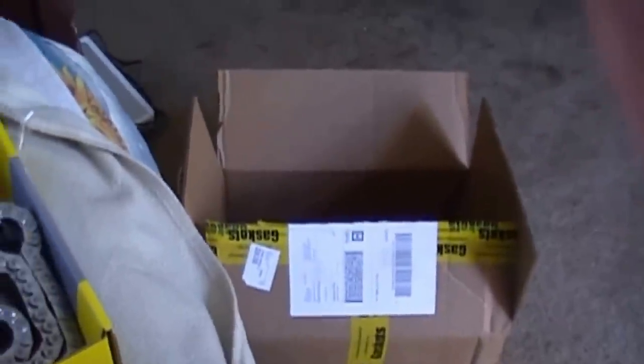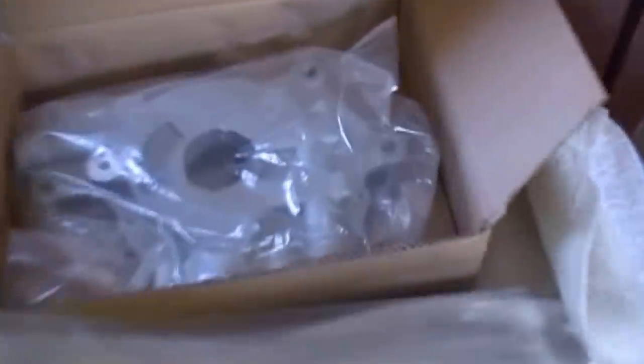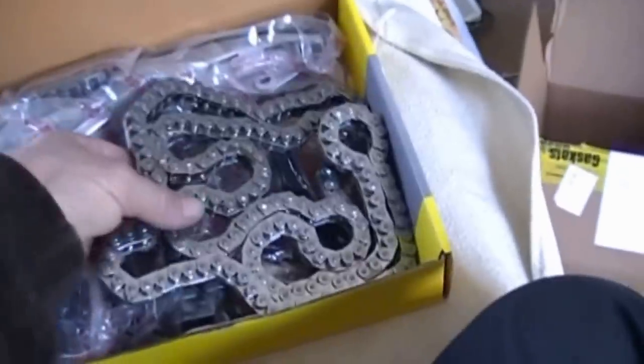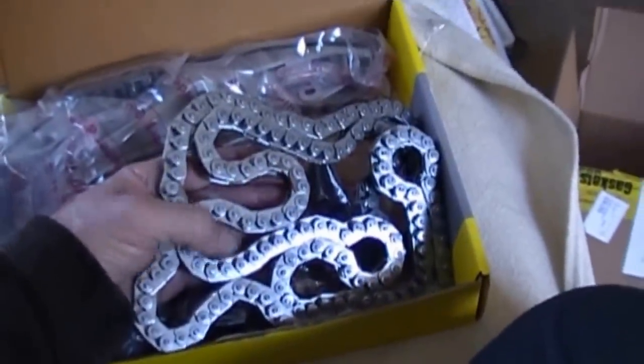I just got my package today from FedEx. I got my guides and chains. I got the oil tensioner brand new, the water pump, a gasket, and all the good stuff to put this car back together - even a brand new water pump. I've got the oil pump and up front I've got the chains. Now when you get the chains, some come with gold links, some come with dark links. When you get the dark link chain you'll freak out thinking there are no timing marks, but there are - you have to look very carefully.